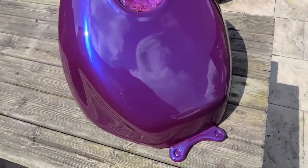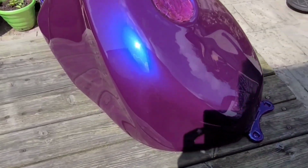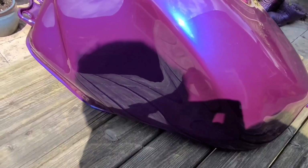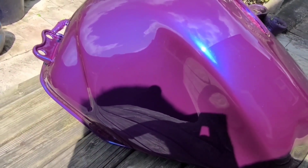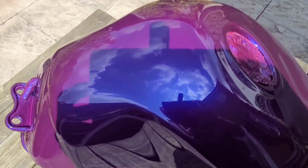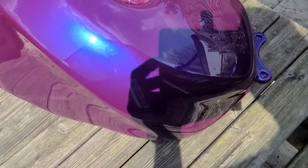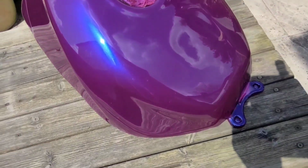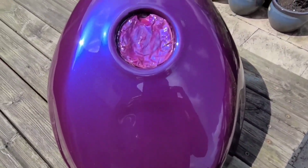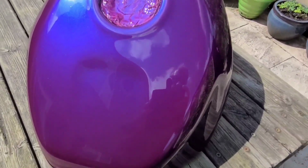I'll just run through the gun settings, because people do often ask that. I virtually always use full fan, because I find cutting the fan back often has a detrimental effect on most guns. So I use it on full fan. I've obviously got the fluid on full. If I'm saying to you it's not putting out enough fluid, it would be silly to have the fluid throttled back and then complain that I don't think it's quite putting out enough fluid.